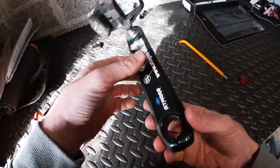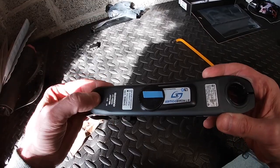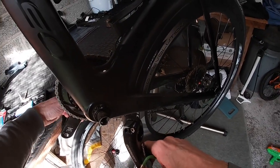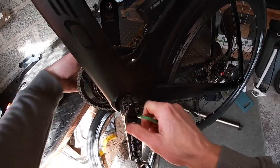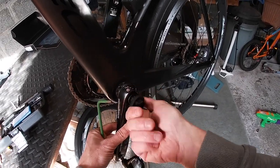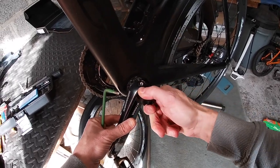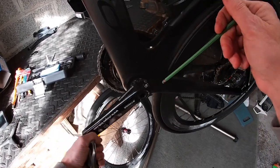We can now put it back on the bike and then sync it up. We'll take the label off and see what's happening. We'll put this back — this goes up to 12 o'clock, this goes straight there. We're going to need the little pre-tension plug, so we'll just screw that in just to get it tensioned up in there. Okay, that's bottomed out, that can come off. Now we'll just do the bolts up with our 5mm Allen key and tension them up.